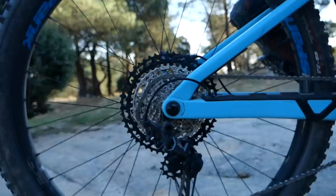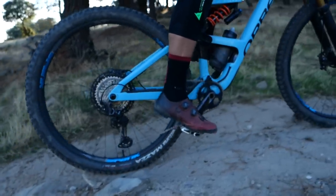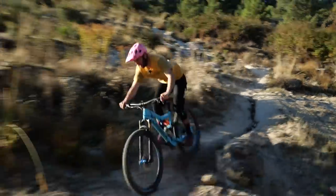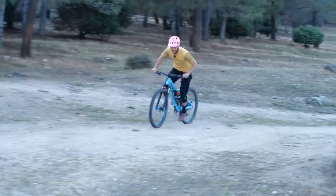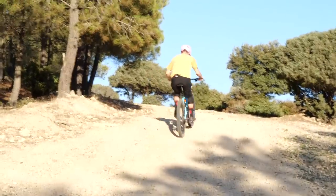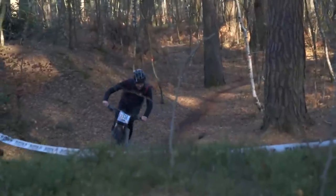Finally, shifting gear doesn't just have to be one gear at a time. Often pros will drop through lots of gears at once, though this is a bit more advanced and only occurs in certain scenarios. A great example is if you've climbed up a really steep climb and you're up there in first or second gear spinning away, but then it crests at the top and it's flat or you drop back down — you'll find yourself banging through the gears quite quickly. Shifting down to harder gears doesn't affect it too much, but the other way — if you're coming down a hill fast and suddenly hit a steep uphill and you're shifting from ninth up to second — well, that puts a lot of stress on the mech forcing it all the way across.